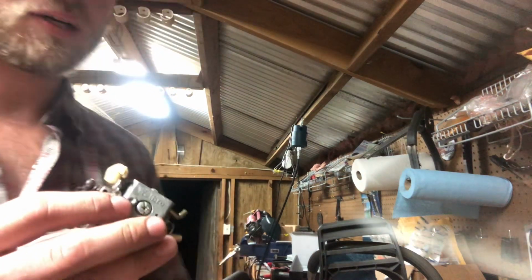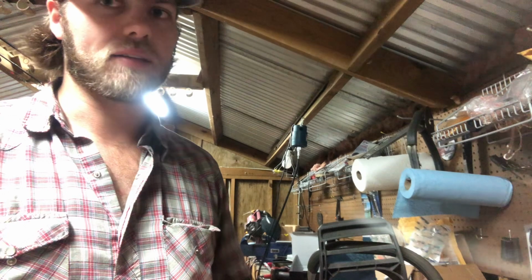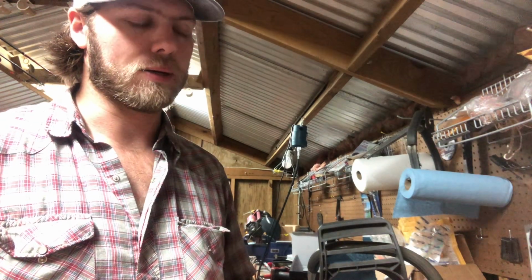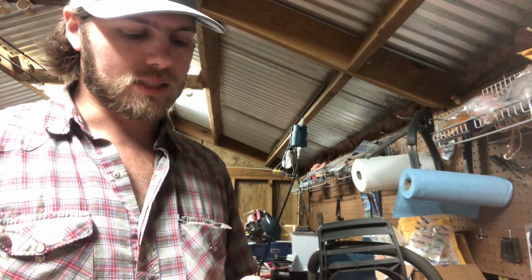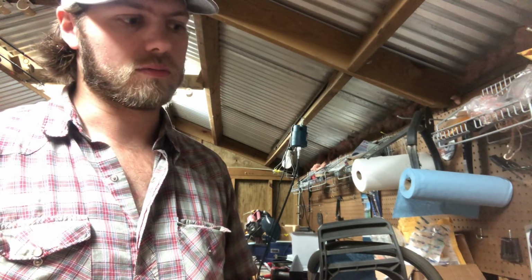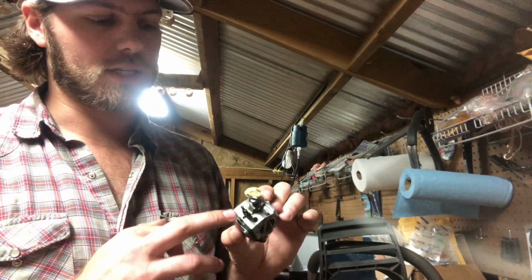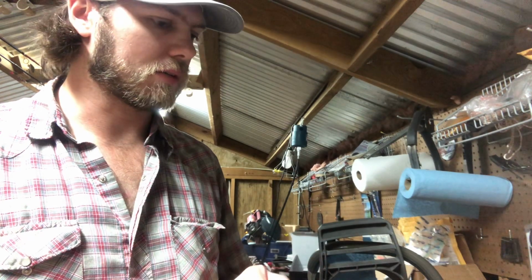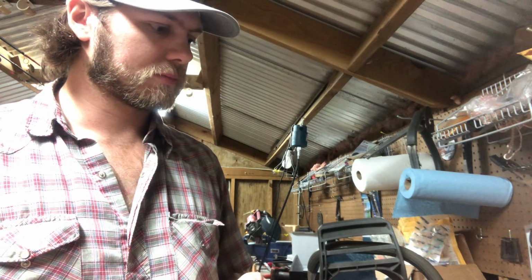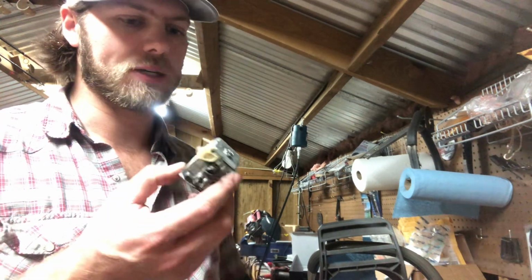It ran decent on the Dolmar, but I believe they truly do require more fuel, even stock, than this could provide. And we'll have to see on the HD12. I haven't fired it up to really see if it is going to deliver enough fuel. But this was governed, or whatever it's called. You can only adjust the needle so far. I pulled that off, so we have full adjustability now.